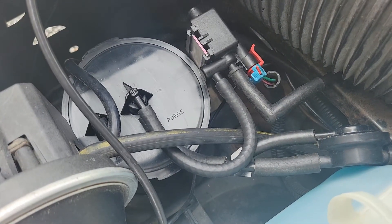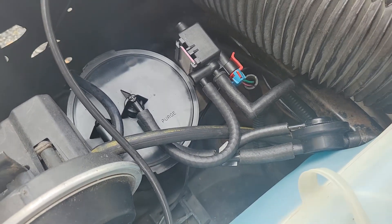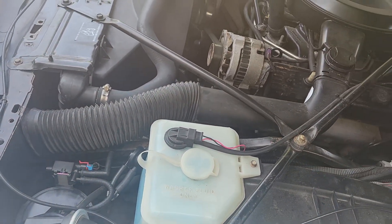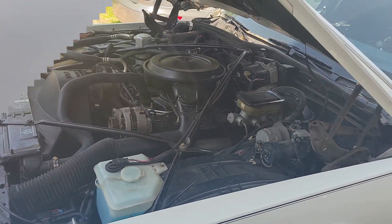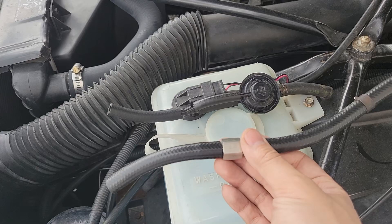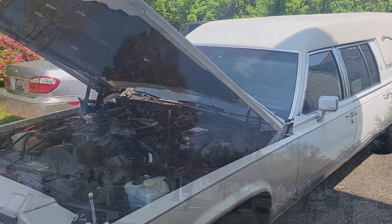Finally, attach the other port on the solenoid to the top port on the canister with quarter inch fuel rated hose. All done. Does this work? And the answer is yes. I've already been on six two-hour-plus long trips with the Caddy, and there's no more engine stalling or even a hint of hesitation. I also used to have issues filling the tank after a long drive — no more gas would go in even though the tank was over half empty. My workaround at the time was to install a check valve in place of the tank pressure control valve. With the new canister in place, I can keep the control valve installed.